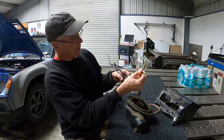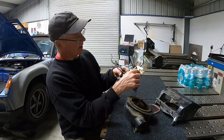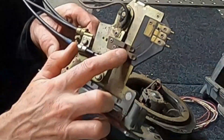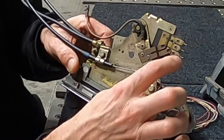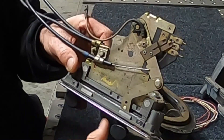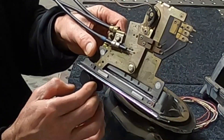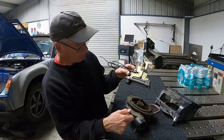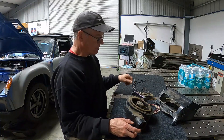And it's grounded. There's one power lead that runs to the motor, and there are three ground leads. And you can see by this fancy switch that as you move it into different positions, it grounds one of three of those leads. And whichever of those leads is grounded runs into the motor and spins the motor at the appropriate speed.